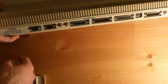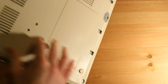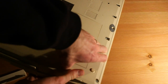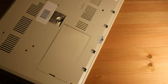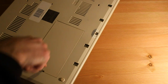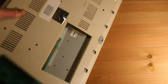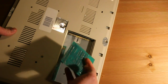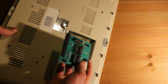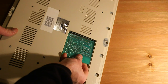And a couple of 9-pin joystick or mouse ports on this end. Floppy drive here — this is what it boots off, it's got no hard disk. Under the back here is the trap door expansion slot as they call it. So we've got an expansion header there and the trap door can take expansion cards like this one, which has got 512k of SRAM and a real-time clock and a crystal. This is the one that was in it when I got it but it had an exploded battery. So that's all cleaned up and just waiting for a new battery, and that plugs in to the system bus.